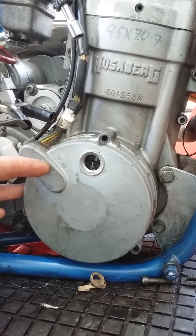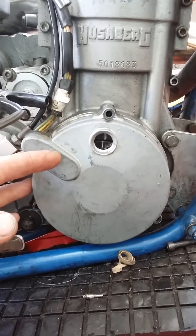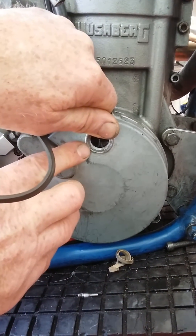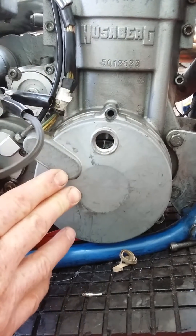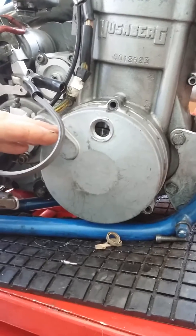Stephen's looking at that and it's pretty much central to slightly to the left of centre. We're on about the lower white line — the static white line — that is half to one millimetre to the left of centre. That is what we think we're going to need to get the ignition timing right on this bike.